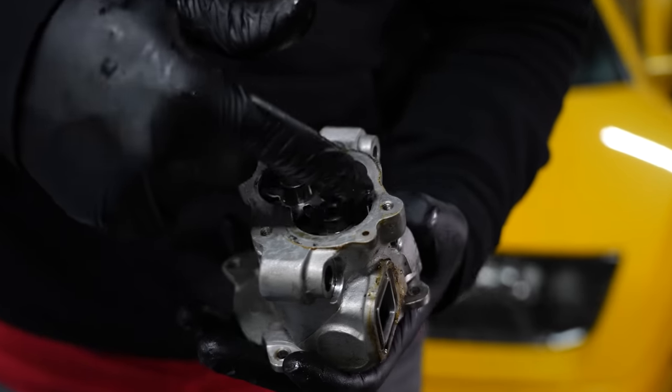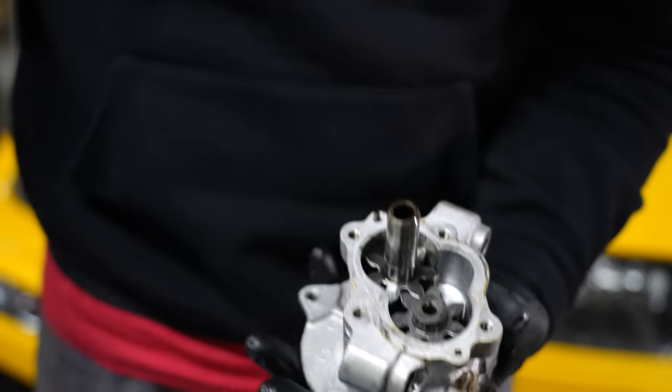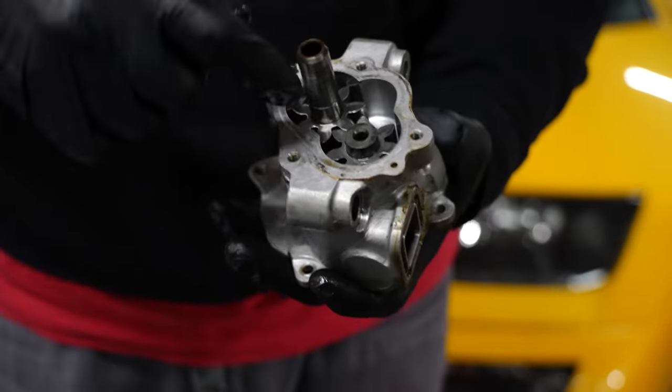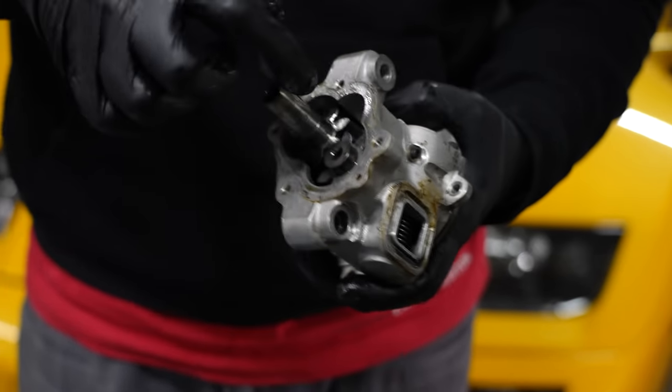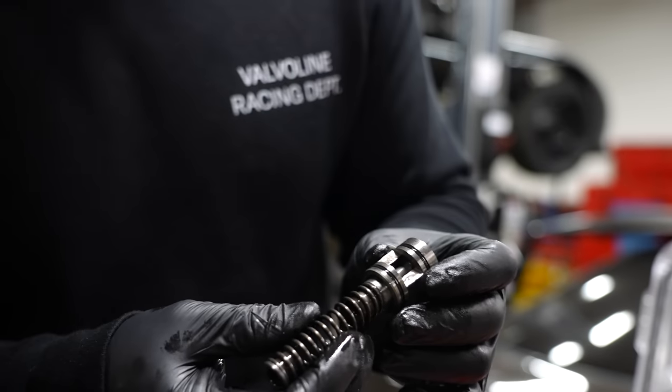Vacuum here, pressure out to here, and then it sends pressure out through this piece. But inside is that hole, and that hole is the oil pressure regulator dumping it back into the suction side. So that spring right there, which is adjustable here, is the oil pressure regulator built into the pump.